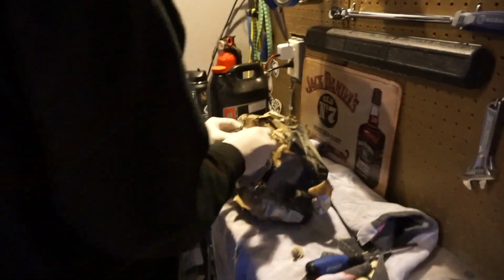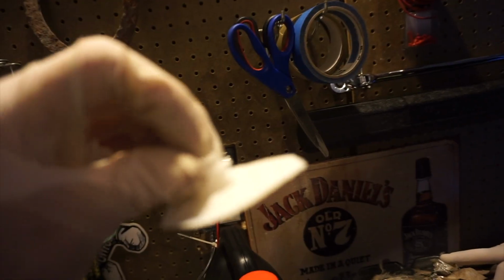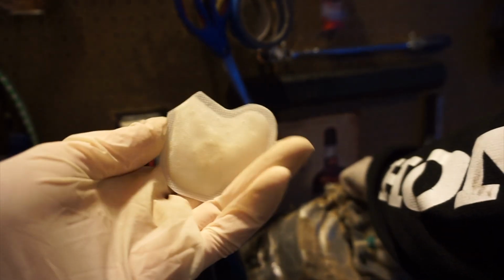Somewhere down the road, we kind of messed up Garrett's bike because now it won't turn over. We messed with the spark plug and replaced it a little bit, and it still wasn't kicking over, so we decided to rip apart the whole fuel pump again. We're coming to the conclusion, which we still have to test, but Garrett thinks that where the fuel goes in at the top comes back down through the bottom, and this was pressed against the bottom because that spacer piece we took out wasn't in there anymore, so it wasn't allowing the fuel to flow through.